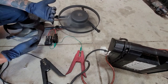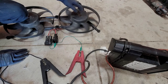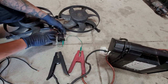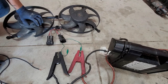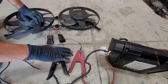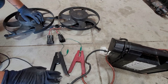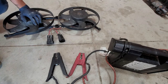If you want to test the other side, you'll see a little spark — don't be crazy, but you can hear the bearing noise as it spins. That's bad. So remember: brown is negative and red is positive for these fans. You would think red is positive — and yes, red is positive, brown is negative. That's how you test them. If the fans work, then check your thermostat, fan switch, or cooling temperature sensor, because that's what controls all that.